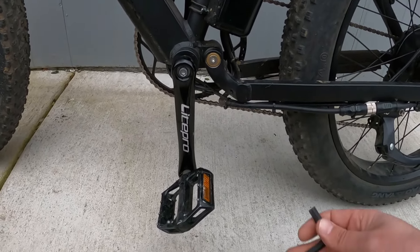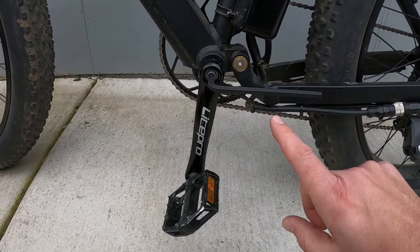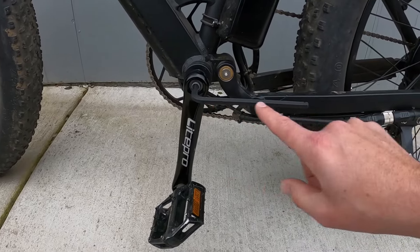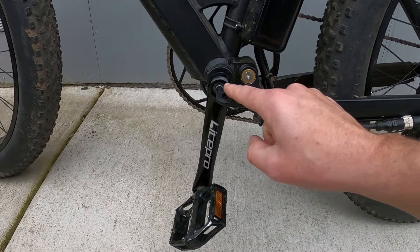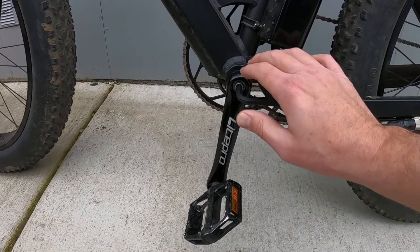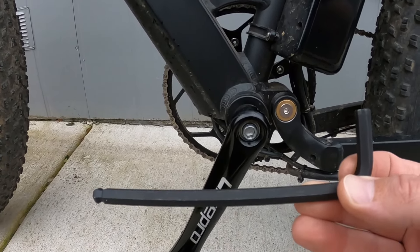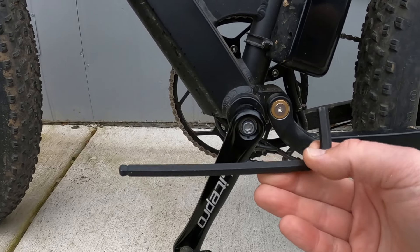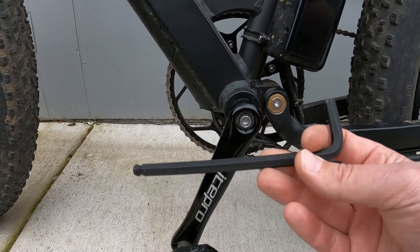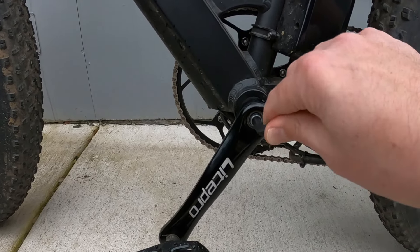So what I ended up getting was this Park Tool eight millimeter wrench here. I didn't have that size on my little tool that I usually bring with me, so I bought this — and I'm actually glad I did because it's much bigger and much easier to get the proper amount of torque you need to tighten this bolt into your lower crank pedal set here. It is an eight millimeter size. I'll leave a link to this particular Allen wrench that I bought. It's a Park Tool and I really love Park Tool's stuff — they're just really good quality. It's only $10. I'll have an Amazon link in the description.